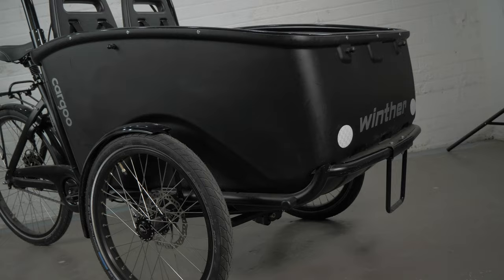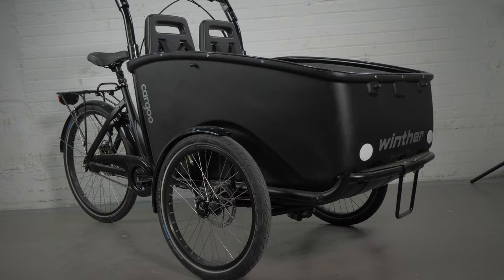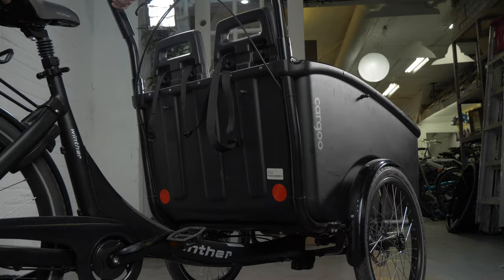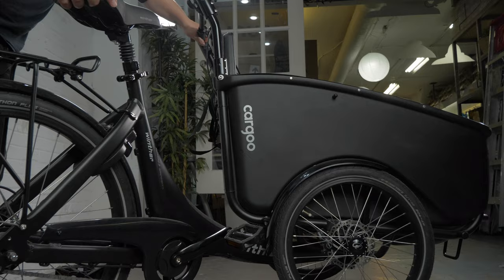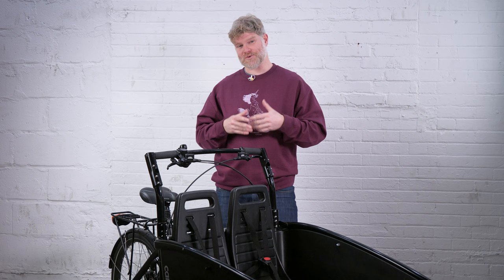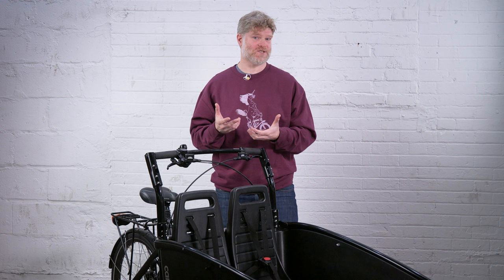The box in many ways is the essence of a cargo bike. The Winther uses something called pivot steering, or box steering, which means the actual box moves left and right instead of just the wheels. The wheels are bolted onto the box, the box is on a pivot, and you basically swing the box left and right to steer. If the box is lightweight, you get impeccable handling; if it's really heavy, you start to lose that handling, making it less reactive in high-contingency situations like riding in North American traffic.